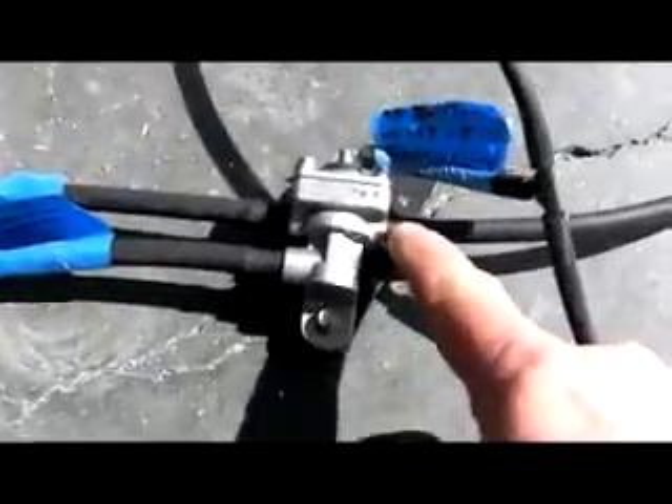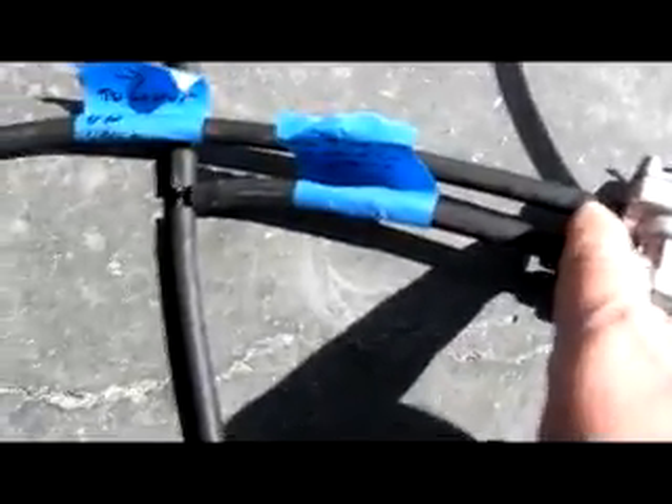There's one little hose right here on the EVAP valve — this hose went on to the catch can down below, on the leftmost side of the catch can. The middle nipple on the EVAP valve went over this way — this was the right-side frame in front of the radiator. You know where the gray nipple is in front of your radiator? That's where that hooked on to, and I'll show you what I did with that nipple too.